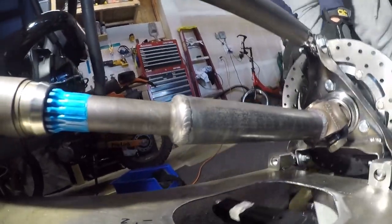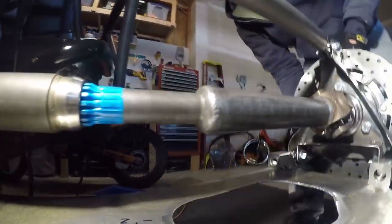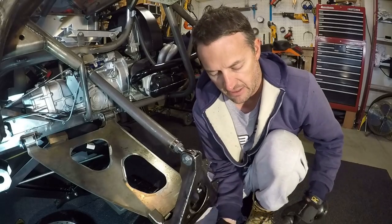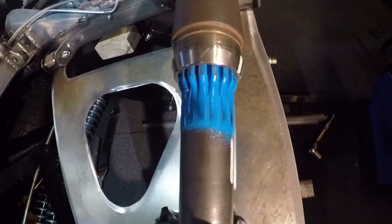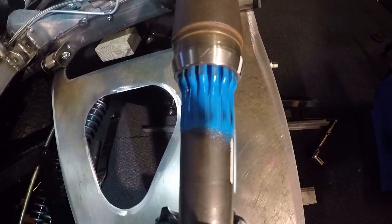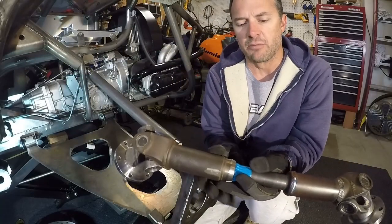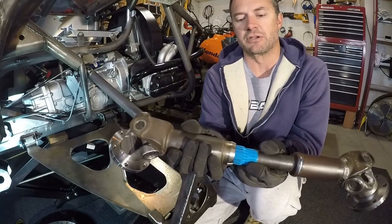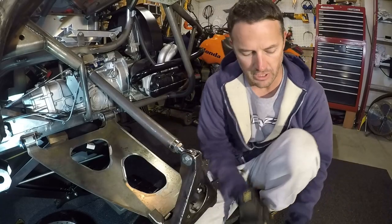What I want to do to eliminate that is design my rear suspension so that my pivot points are as close to where the u-joint pivot points are as possible. The closer I get them to those pivot points, the less spline movement there should be as my suspension travels — because if my u-joint pivot points were exactly in the same spot as my control arm pivot points, there would be zero change in my spline. I don't think I can get it exactly the same, but I'll get as close as I can, mock it up, and see how much the splines move.